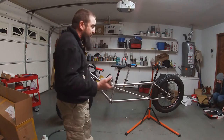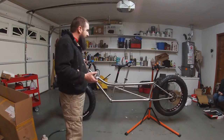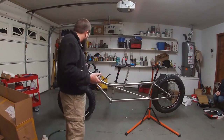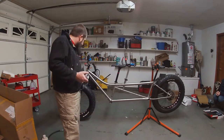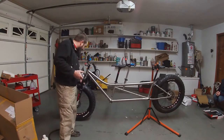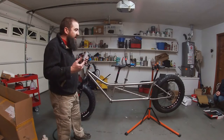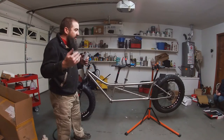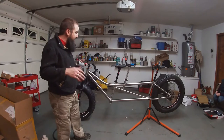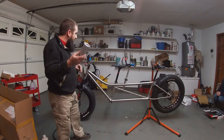We obviously have our tires, our 220mm Magura rotors, and our 780mm bars — maybe a little wide for the Stoker, we may cut that back. Saddles of choice. Headset is in. We have our Mastodon Pro Extended here, which has plenty of clearance for the widest of the wide tires. And our V Snowshoe 2XLs on Surly My Other Brother Daryl 80mm rims. We installed the GX cassette on the other side. So all we have left to install are the drivetrain and brakes.